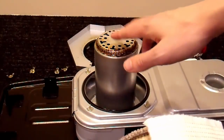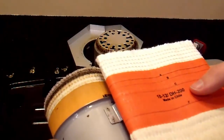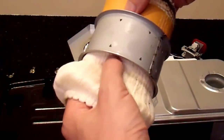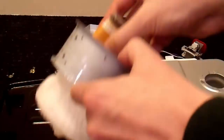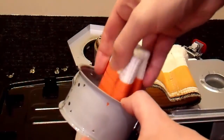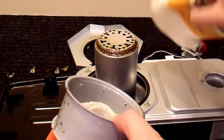If I crank the knob all the way up and install it too high, the flame will be too high — but I just won't crank the knob all the way. And I don't want to make it way too high, because when I try to extinguish the flame it won't extinguish. So I'm going to line it up with line B. To get this wick out, there are some metal tabs here that clamp the wick in. We're just going to remove the wick from those metal tabs, fold it up, and remove it — and here are those sharp metal pieces.